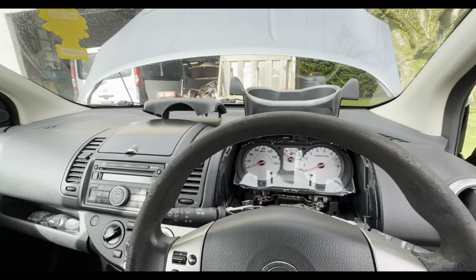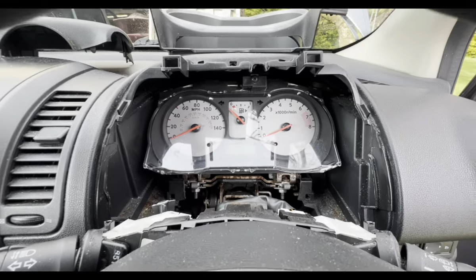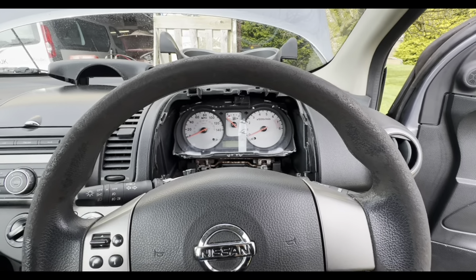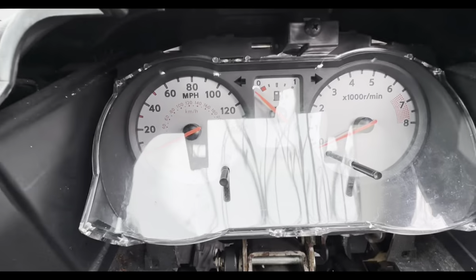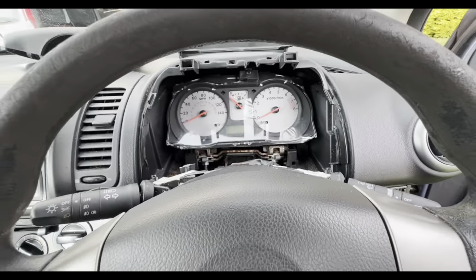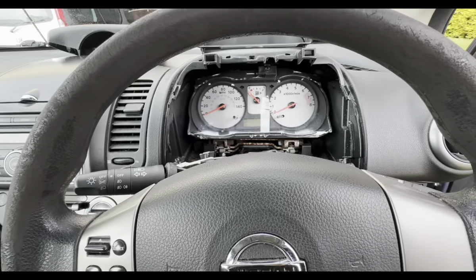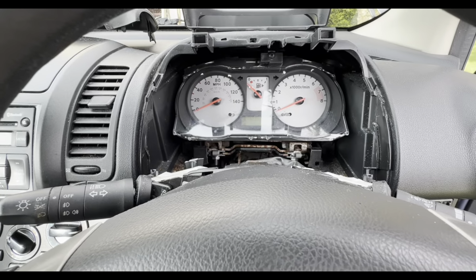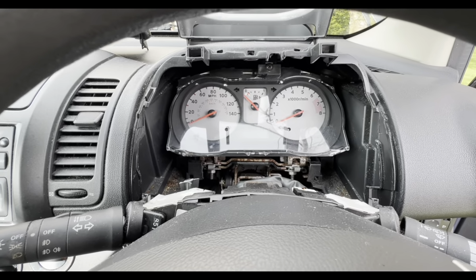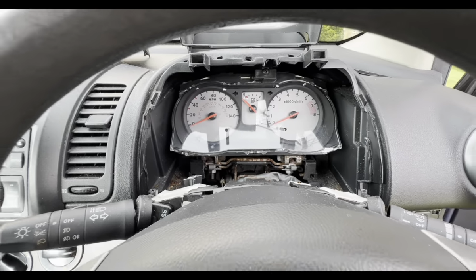because the customer's coming for this in a bit. So basically the instrument cluster itself is drawing the power. F14 controls the instrument panel illumination, and somewhere in that instrument cluster power is being consumed. So basically disconnect the fuse, and the current draw from the actual parasitic draw goes all the way down to below 10 milliamps. So it was just basically disconnecting the instrument cluster, and it confirms that the instrument cluster is drawing power.